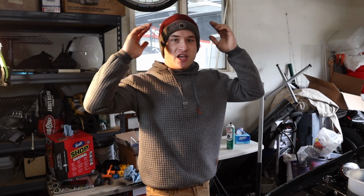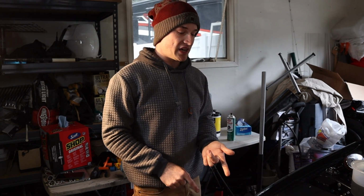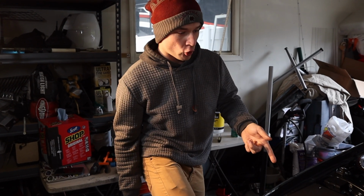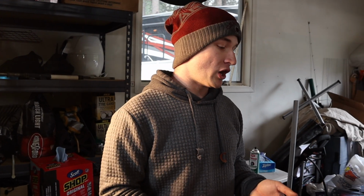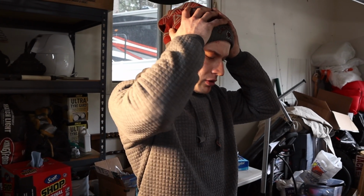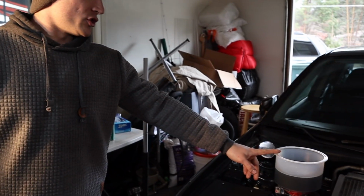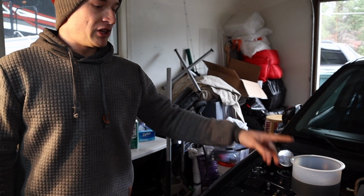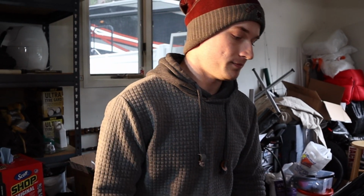I'm going to pull up IAG's break-in procedure. IAG has a great break-in procedure if you go on their website, for either rebuilding your own motors or buying a short block from them and slapping it in. I'm going to follow those procedures. I'm going to put a cap on this right now, just so coolant doesn't spill everywhere, and I'm going to let it idle for a little bit. I'm going to figure out what that belt problem is.